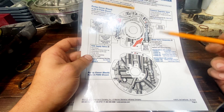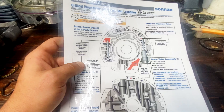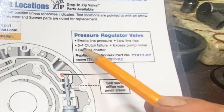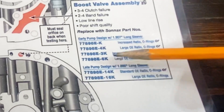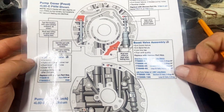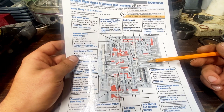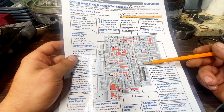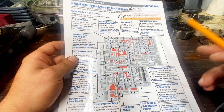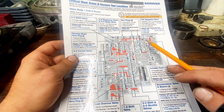We flip it over on the back side, and this is a diagram of our pump — and we'll show vacuum testing locations too. Right here, our pressure regulator valve can cause a 3-4 clutch failure in and of itself, along with the boost valve. So there's two components in the pump that can also attribute to that. Hopefully this helps understand why vacuum testing — not only the pump but the valve body — is so important. If these ain't good, your 3-4 ain't gonna live a long life no matter what you do in the transmission case.